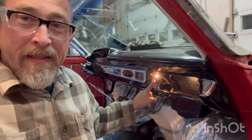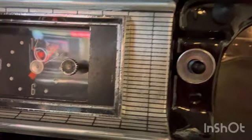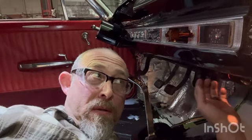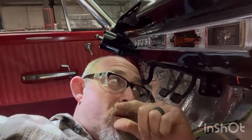So anyway, here we go. I mean, look at, well, messing with the glove box light. I seen this blue wire right here. That is the clock wire. Okay, if you'll see in here, listen. Oh, it quit working. It was working. I touched that blue wire to power and it worked. But not like I just touched it and then it come off and the clock was still working. Now it stopped again.